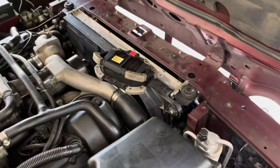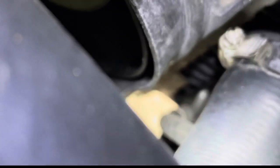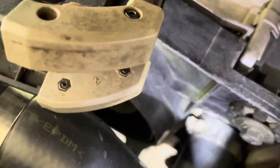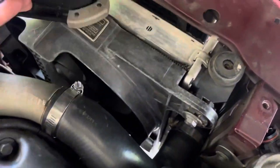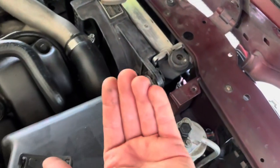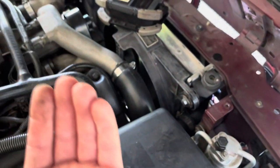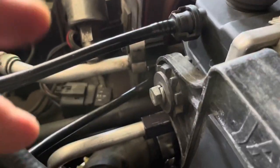Now the passenger side — here in America, passenger side. When you pull the radiator up, you'll have to clear that hose right there — it's another condenser line. You have to clear it, but it will clear. Pull it straight up and just be very cautious about that. What I did also right here: I loosened this up and pulled this whole thing over, twisted it over so it was actually hanging up out of the way of the radiator. That gives you more room. When you pull up, pull it carefully. Watch this line here — get something to move that over to the side. That line right there, also be very, very careful. Pull straight up and you'll be okay.